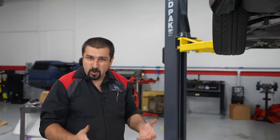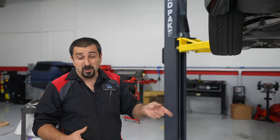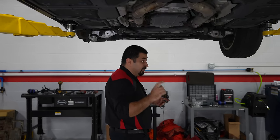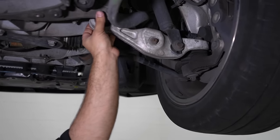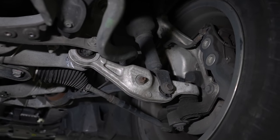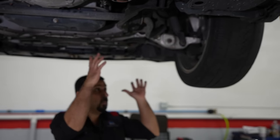Is this a 2008? Because this is a 2008 - it's a little old and the values go down. You're not going to put a lot of money into this; it won't make financial sense. Think about how long you're keeping this car and what else it needs before you start the conversion, because these conversion kits are not cheap. When you check one of these, look for two important things. Other than the air suspension, this lower rearward arm is what starts all the trouble. When this arm goes, it's going to put load on all the other ball joints unnecessarily and destroy everything. If this looks original and has issues, replace it.